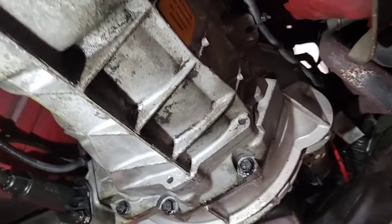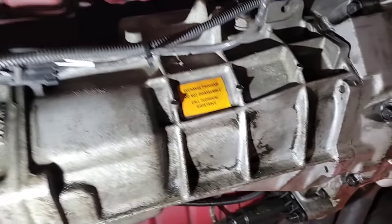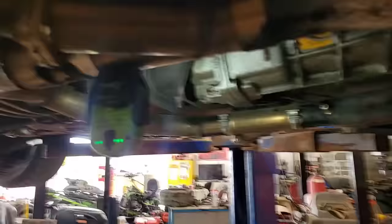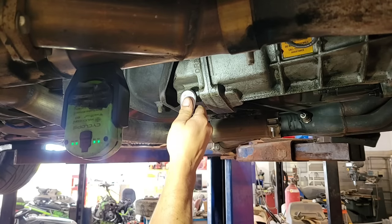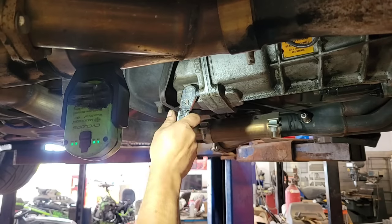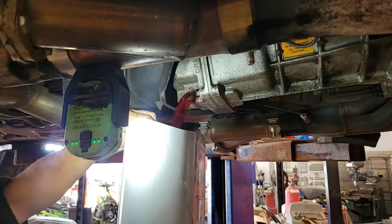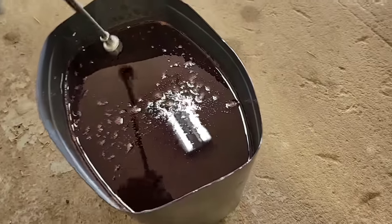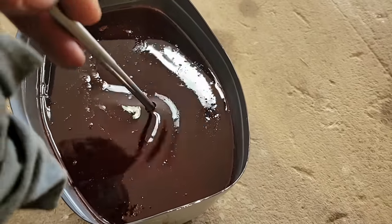We're going to pull this tranny out. I think because it's making some funny noises, first things first we should drain this and make sure there's no surprises — no chunks, no extra bits. We'll use a used jug as a drain pan so we can check when we pop this guy out, make sure there's no surprises. These things are good — just has the regular plug in there, 3/8ths. Crack it loose. We're running some tranny fluid out of there. The fluid came out looking pretty clean.